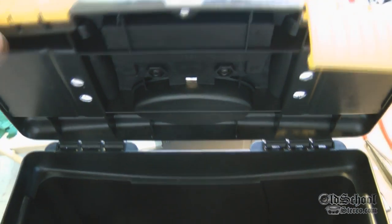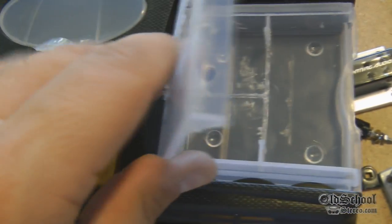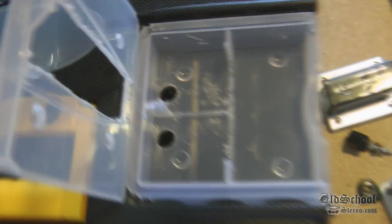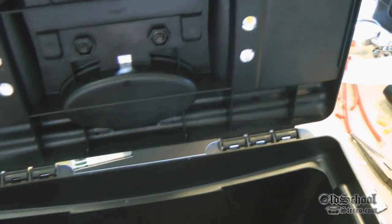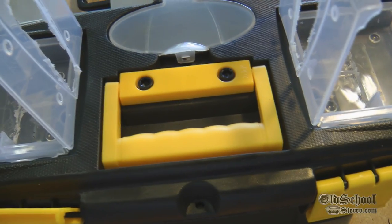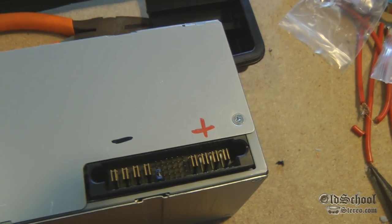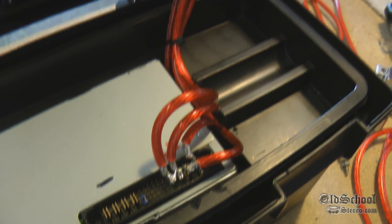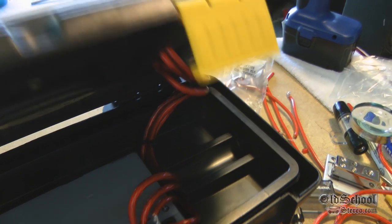As you can see we have the three-eighths inch holes drilled, two on either side. I drilled straight through the little plastic tray and through the top of the toolbox so we can run the wires up through here. We're getting really close. Now I'm going to put the power supply back in, run the 10-gauge wire up, and go ahead and connect the distribution block so we'll know how much wire we need to solder on to the leads. We've got one side — the positive side — all soldered up, and the wires are a little bit neater this time with tie wraps.